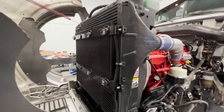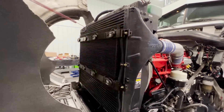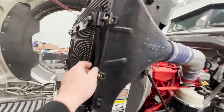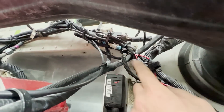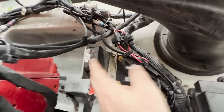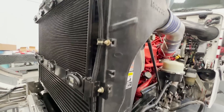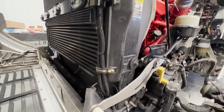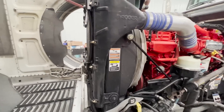We got all our wiring done. Jay's in the truck — he's going to fire the lights up. We got our eight strobes going, they were pretty bright. Wiring-wise, Shock basically ran the wire straight down, back behind the radiator, tied up to the existing wiring harness inside the frame. It runs all the way back, comes up the firewall, and we got it tied into where he had his original wire. Done deal. We just used gel clamps — super clean, won't give many issues, very sturdy. Now we'll flip the hood closed and see what they look like.